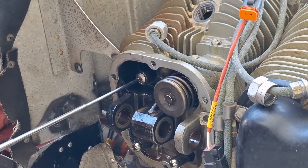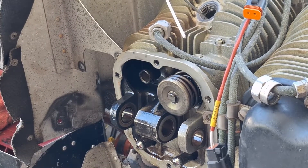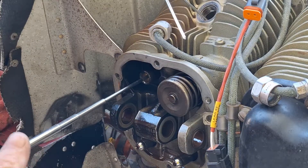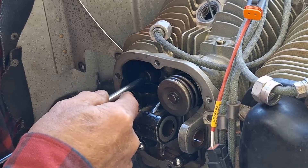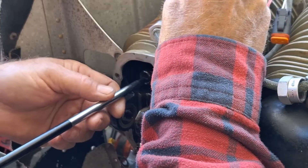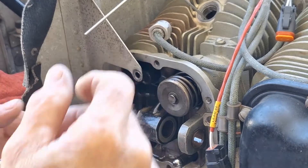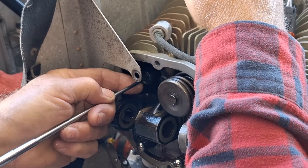This one's a little snug today — let me try my other one. The magnet will slide through the hole now; it had a little burr on it so I cleaned that up. I'm going to grab a hold of that valve and lift it up a little bit until I get a hold of it with the magnet. There — I've got a hold of it, and I can see that I'm lifting it up. I've got a hold of the valve with the magnet and I'm kind of lifting up on the guide a little bit as I pull it back in.